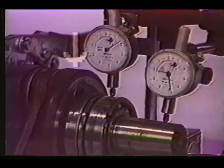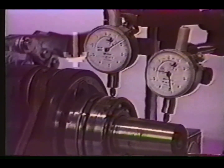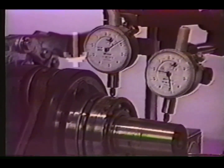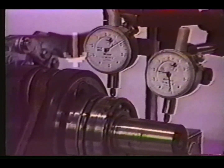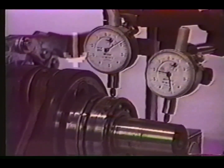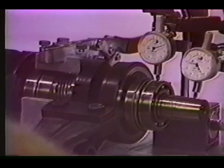In this case, the dial indicator shows that the high part of the crankshaft is with the rod pin in the up position. The inner dial indicator on the bearing shows approximately 2 thousandths, and the outer indicator shows approximately 5. This indicates that the crankshaft will have to be pinched directly opposite of the rod pin to bring the end of the crankshaft down. You are actually just moving the crank wheel on the pin. This operation can be done with the crank in the fixture.